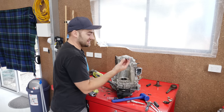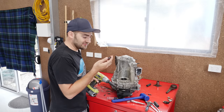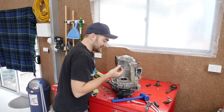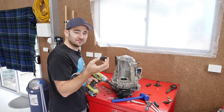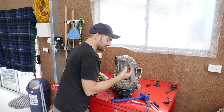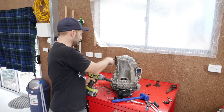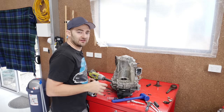I've managed to do one of the trickiest bits, which is getting this cap off that lives in the top there. It's pretty innocuous looking - you wouldn't really think that it's so important, but it turns out that it is. That one's in okay condition. Getting it out is really tricky. These are probably consumables. If you are doing this in a dealer, you'd probably just have heaps of these on hand. This one's actually not too bad - it could probably go again. Now I need to release a circlip that's on here and then remove some other bits and pieces so I can see what I'm doing, and then we can separate the cases.